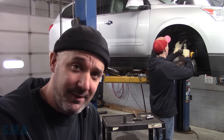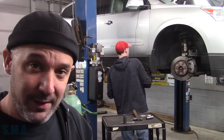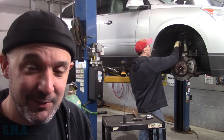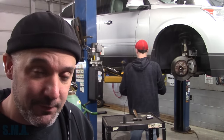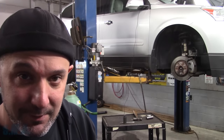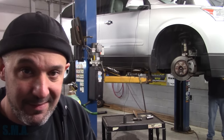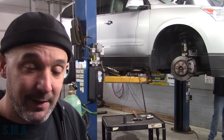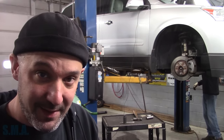Almost forgot about you. It's the next day or two later. Anyways, that front differential went good. Jason put it back in the front of that Chevrolet or GMC, I guess it was, the Yukon. Took it for a ride. Front's nice and quiet. Four-wheel drive works. No longer peeing out the axle seal. Like I said, that was our original customer complaint, which had its own hidden blessing by finding that broken clip and then discovering that the carrier bearings were wasted there.